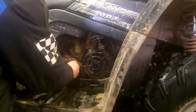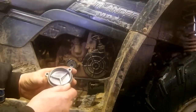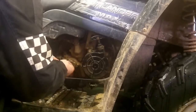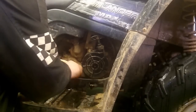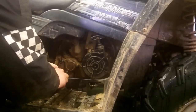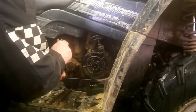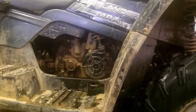Get the cover all cleaned off inside. The rubber seal is still in good shape, we'll put that back on. Make sure that's centered in there nice. Get these all started evenly before we tighten them up. There's the new filter back in. Next we'll put the plug back in underneath and add some oil.